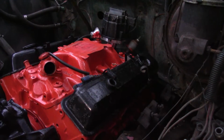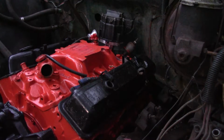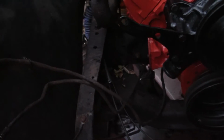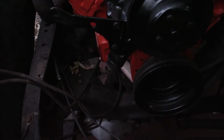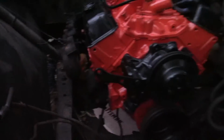And we'll be changing the transmission gasket, filter, and fluid in it, not the pan itself. Running new lines on it. I don't know how well you can see them because it's starting to get dark, but they're just as rusty as they can be. And actually underneath the block by the frame, one of them has enough of a crack for it to leak. It doesn't spray, but it's enough for it to drip, so we're going to get the lines replaced. And I did get the fuel lines and everything all cleaned out, so we'll be able to get all that hooked back up and run like it should.